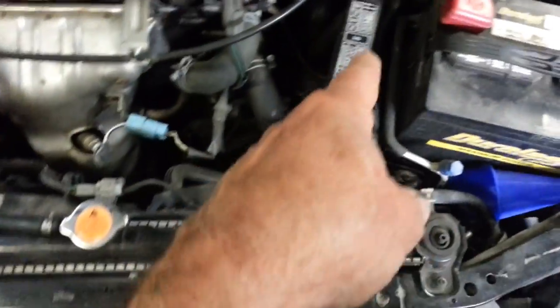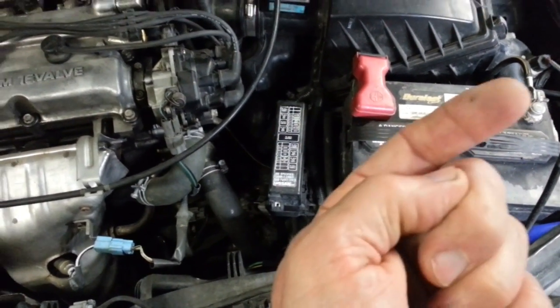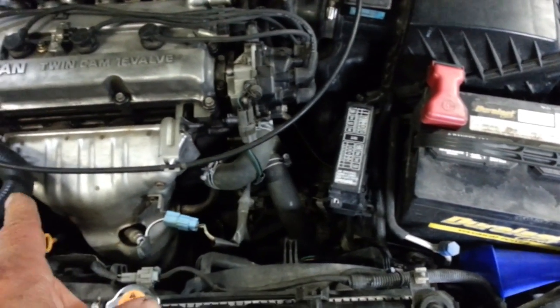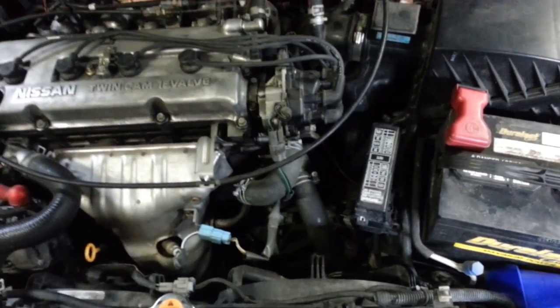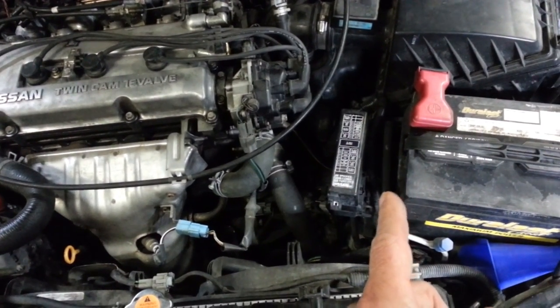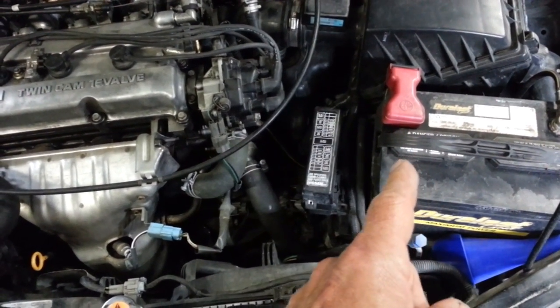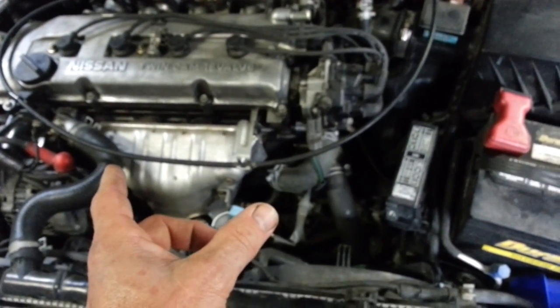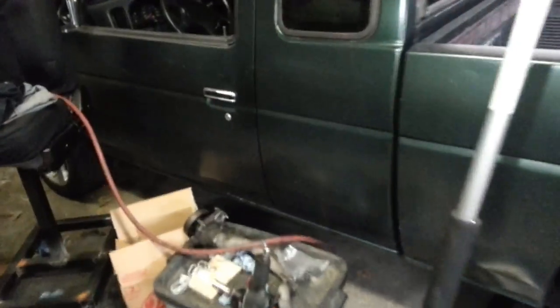The last time I tried to pull the engine and tranny, there's a mount down here on the tranny and the tranny is actually bigger than the engine bay, so the tranny couldn't come up. I ended up dropping it off the bottom, taking it apart, pulling the tranny off and pulling the engine off the top. When I put the engine back in, I put it in from the top and then put the tranny in from the bottom — that was pretty easy. But I noticed the frame has a removable transmission mount, so I'm thinking maybe I can pull the engine and tranny as a unit out the top, just like you do on a rear-wheel-drive truck. So let's see if it's doable.